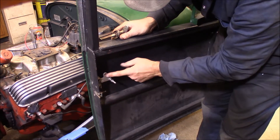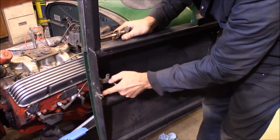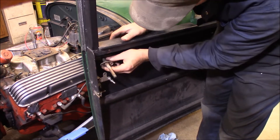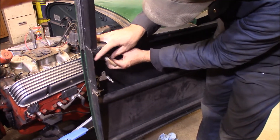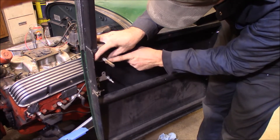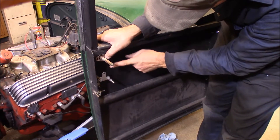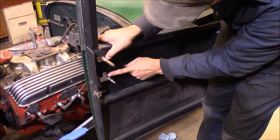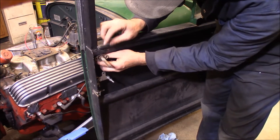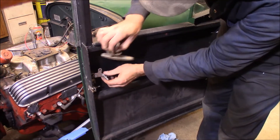You can see this can either be set to pull or push down. So what's going to happen is, when the door handle's mounted on the outside of the door, the square shaft's going to come through, and I'm going to have a little lever arm mounted off the side of this, and it's going to bolt down into here with a little linkage. So when you turn the handle down, it'll push down and open the door.